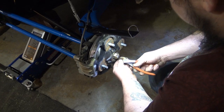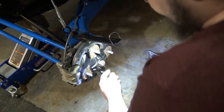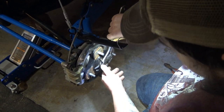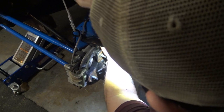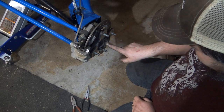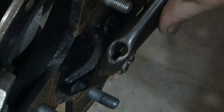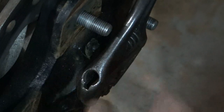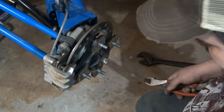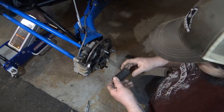So you bend the bottom out of the way and get it as straight as you can. It's still too tight here. Sometimes after you tighten it you get the cotter key in there and it backs off — the cotter key is doing what it's supposed to do. You can see it's still at an angle, so either get a crescent wrench to turn it the opposite way to un-pinch it, or just take a pair of side cutters to pull it out — you'd normally replace that anyways. This is a 27.